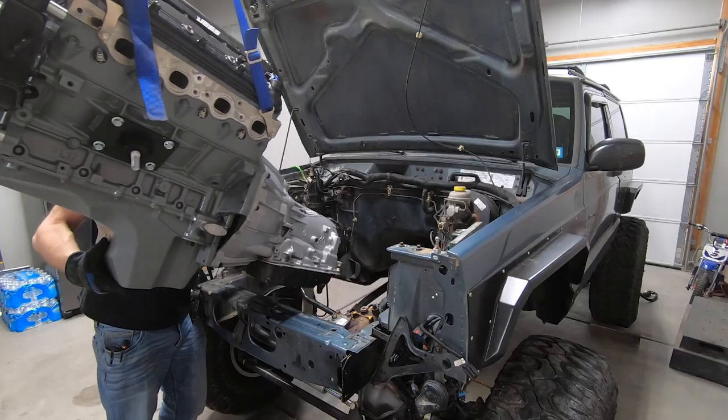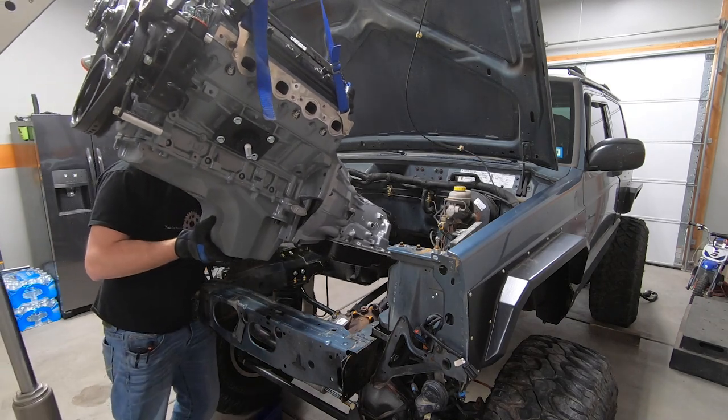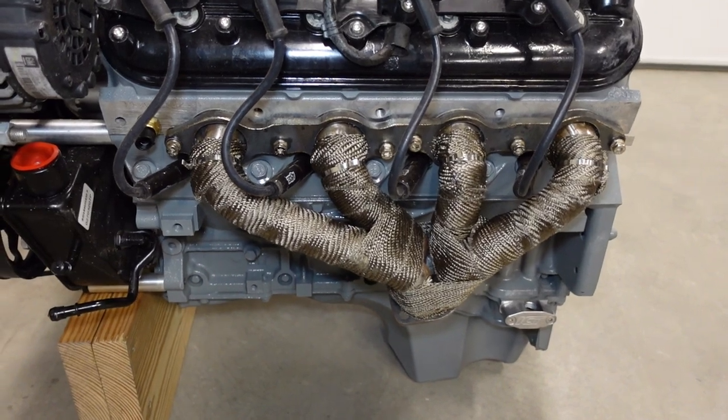There's just a whole bunch of cool parts on this thing and we needed to make more horsepower. So I was tasked with installing and swapping a 6-liter LQ4. It's got a small cam in it, headers from Novak, running the Novak conversion mounts, an LS6 car intake, and an LS Simple accessory drive. The very last thing I showed you was the fuel system - we used a Novak fuel adapter to run the Jeep pump in the tank, then a Corvette-style external filter/regulator assembly, and ran the fuel lines up to the engine.